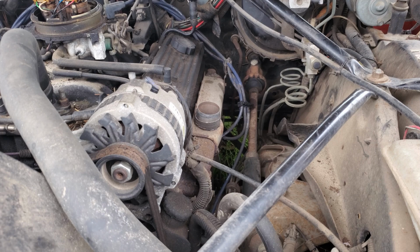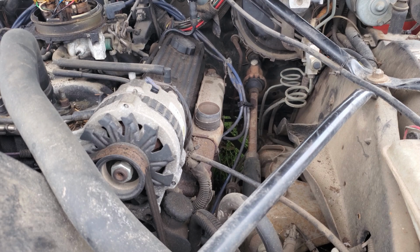I'm at the point where I think I'm gonna pull the fuel filter, turn the pump on, put a catch pan under the fuel filter, and see if the fuel pump pumps. If it does, obviously look at the fuel, I'm sure it's terrible, but more or less just cycle the key maybe till the tank's empty. I also got to see how much fuel's in the tank, because I have it unplugged right now, so it reads full, but I've got no idea whatsoever. So we're gonna bring it back up to top dead center and look at it a little bit more.